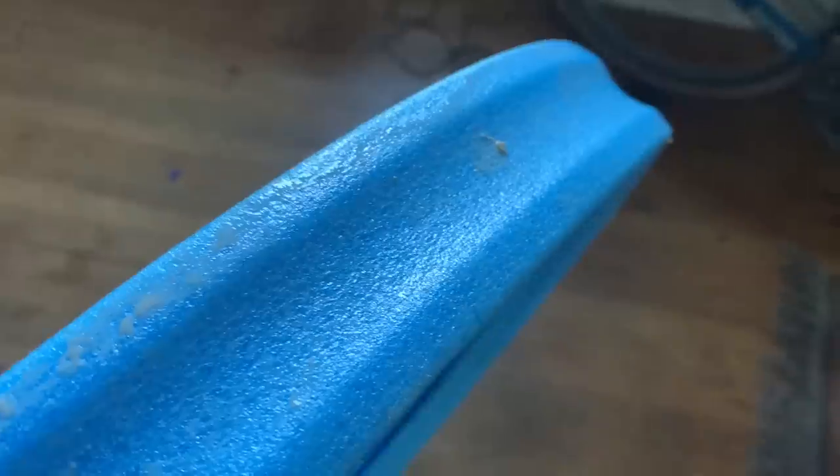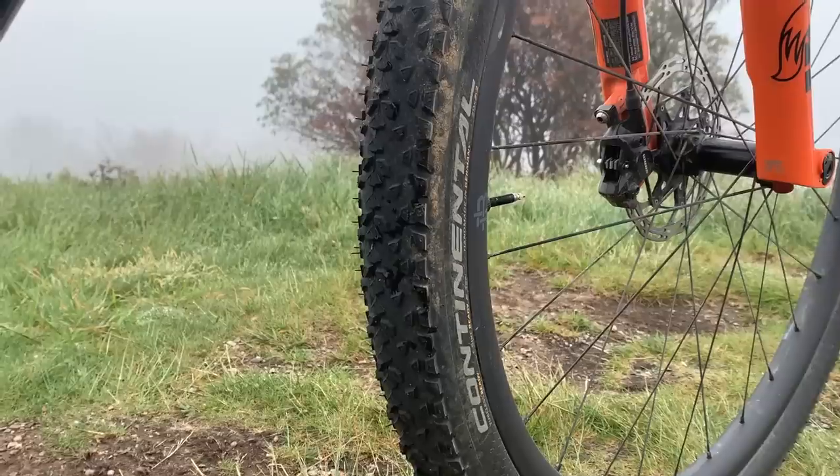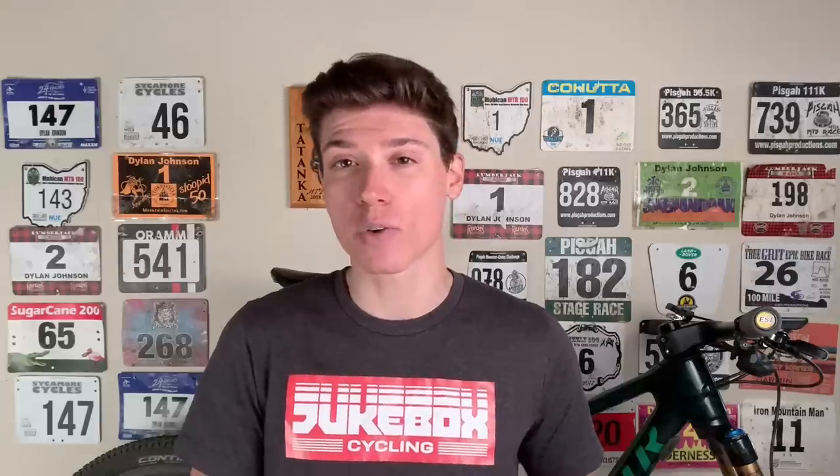If you're a regular viewer of my channel, you know that I'm a big fan of tire inserts for the gravel bike, and yes, I also use tire inserts on the mountain bike, depending on the course and how high the risk of puncturing is. Big square edge hits where you can easily bottom out the tire are where the inserts come in handy. I use the Tubalight Evo SL insert because it's the lightest mountain bike insert on the market at just 58 grams, and I pair that with Silca's new Ultimate tire sealant, which I've yet to get a puncture with. Inserts will also allow you to run lower tire pressure, which increases comfort and grip, and can decrease rolling resistance on rough terrain.